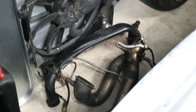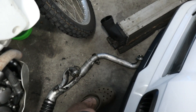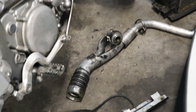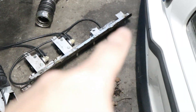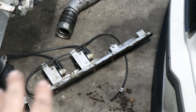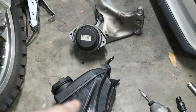Let's start back at the inlet pipe and the downpipe. Obviously the downpipes have to come off. The front inlet pipe is going to be in the way of a lot of things, so you can see that we removed it right there and put it aside. Now, after that, in order to get the boost pipe off, you're going to have to remove the intercooler. Then you're going to want to remove the boost pipe — this is just clipped onto the intercooler here, and it's got 5mm bolts that hold the clamps that go to the turbos. Right here is the rail with the vacuum solenoids, held on by some E8 bolts. When I found that missing bolt earlier, it actually came from one of these spots here — these are E8s. You're going to get that out of the way and disconnect the vacuum lines from the turbos and from the canisters as well. You can see we removed the canisters as well as the expansion tank, and that made a ton of room to see the manifolds.